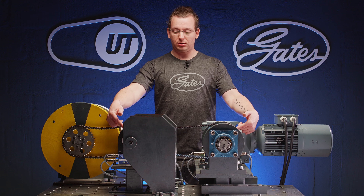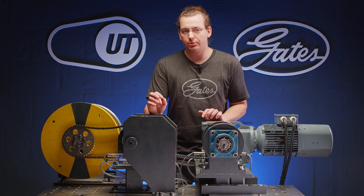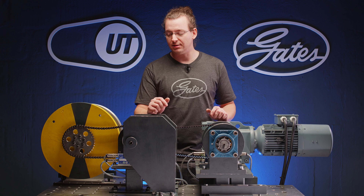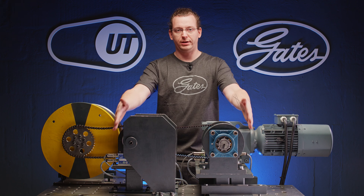These two are the torque sensors and this is where the magic happens. They have a very high accuracy of 0.03 percent, which is very precise and helps us to determine our losses in this drivetrain section.